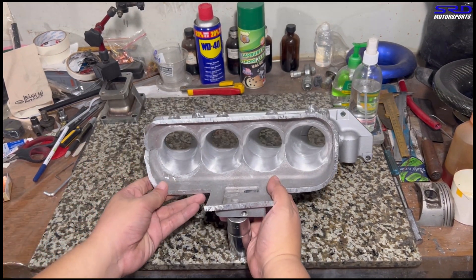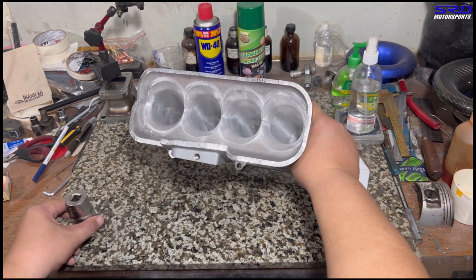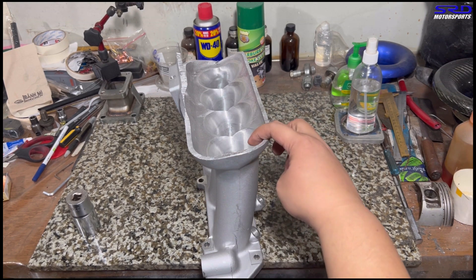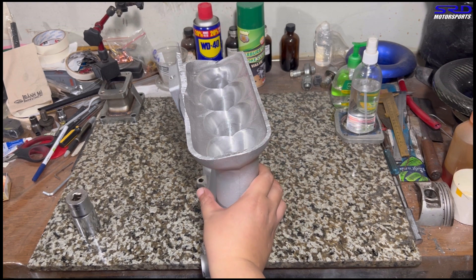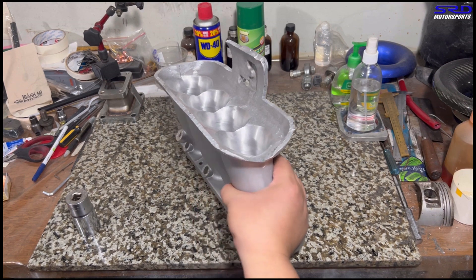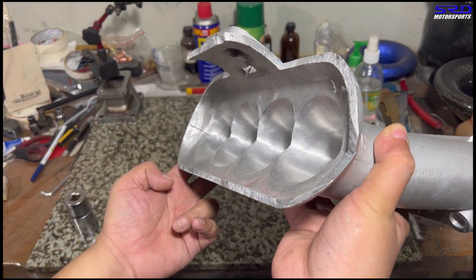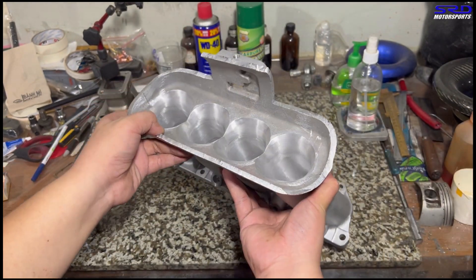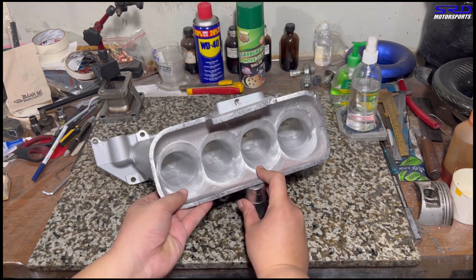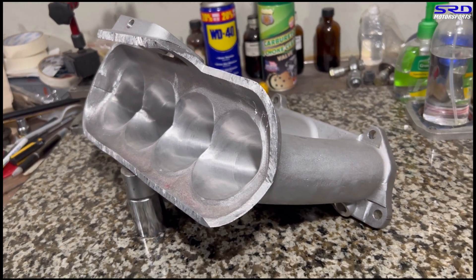From this angle you can see the 120 grit — we did several passes — and the taper has improved significantly. Compared to an unported manifold, this will be significantly better. On the opposite side the taper is really, really good. The first inch or the first two inches of the entry, the smoothness is a lot smoother — that's because we just made several more passes there. On a camera phone it's not really that visible, but in person you can actually see the difference. That taper is really, really good.